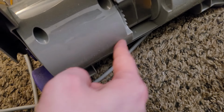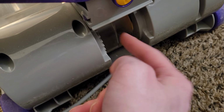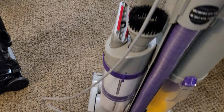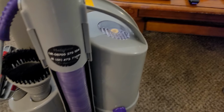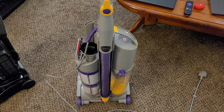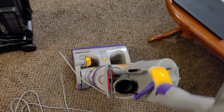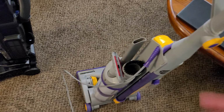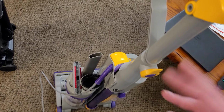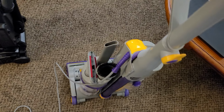And of course, like every Dyson, this bottom portion always gets scraped along this bottom section. And we can see part of the changeover valve, which is actually built into the hose, strangely enough. And just like the Phantoms, although not as bad, although much more aggressive than the Phantoms, this thing completely cuts itself off and chokes itself when it's in the upright position and the wand is locked in, because it just completely cuts off its air and relies on the changeover valve to bleed off air, which can't be good for the motor, but it's still running, so they must have done decently. That's why there's no vent holes here. It's not necessary, because there's no air rushing through this when it's actually on the machine. It's once you release the wand that you then feel the air coming in through the machine, through the wand specifically.